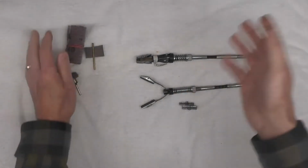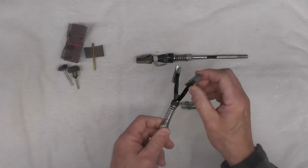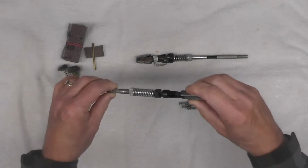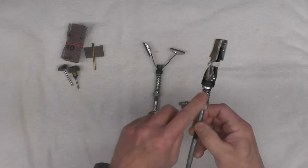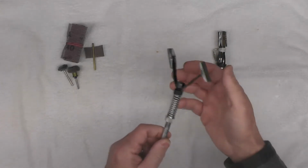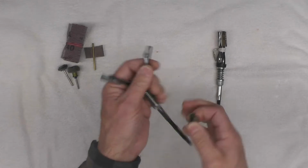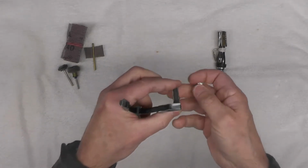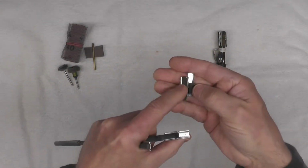There are other ways you could approach this. The way I'm going to do it is with a brake hone. That's what these are, cylinder hones. I actually have a couple of them, as you can see. This is a 3-shoe hone. These are inexpensive. And this is a 2-shoe hone. I just replaced the shoes on the 2-shoe hone. Here are the ones I just took off. I don't know if you can see those or not, but they're pretty well worn. In fact, this one's missing pieces of the shoe itself, the abrasive.